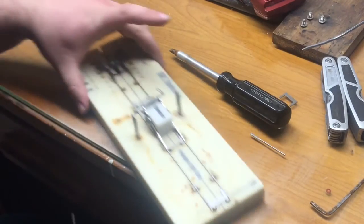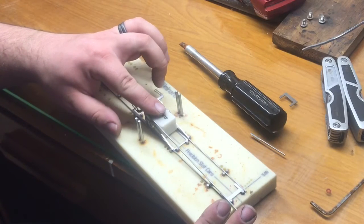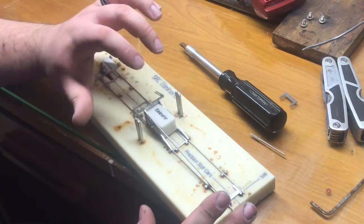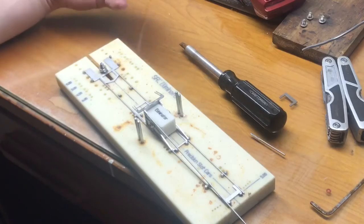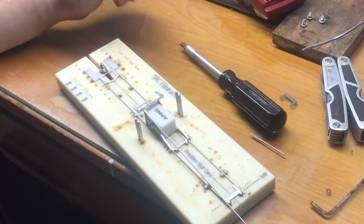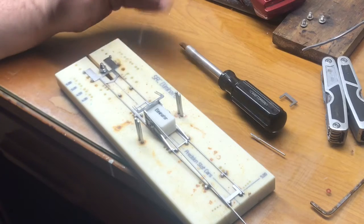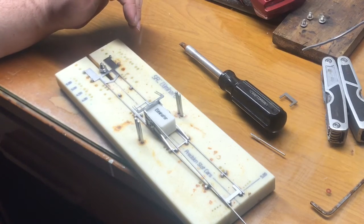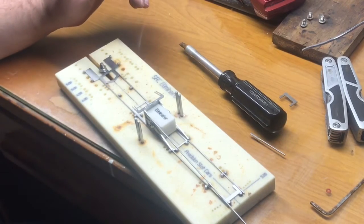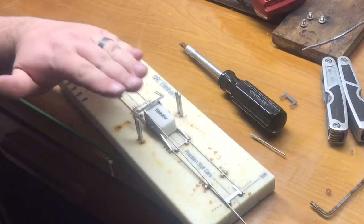And then the rear down struts, you could go up into the upper, which in my opinion, if you're going to do a big power motor in it, I would definitely go to the upper. Downside is you're going to have to notch a little bit higher into your rear bumper. Some guys, it's a big deal. Some guys it's not. Me, it kind of depends on what I'm trying to achieve, but I ultimately know that with this chassis design, anything with a wheelie bar, you're going to end up having to notch, or you're going to have to set the body up on top of it.